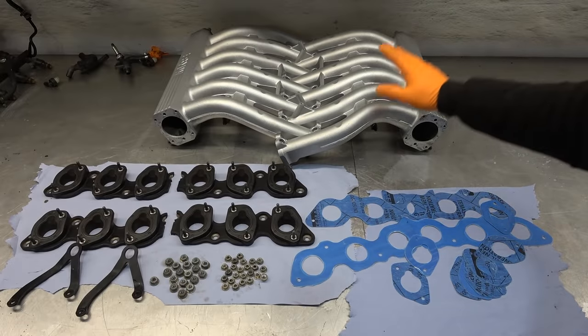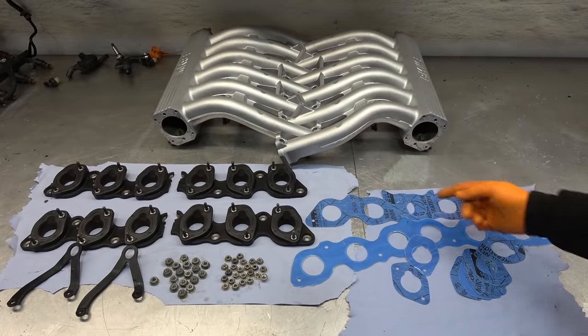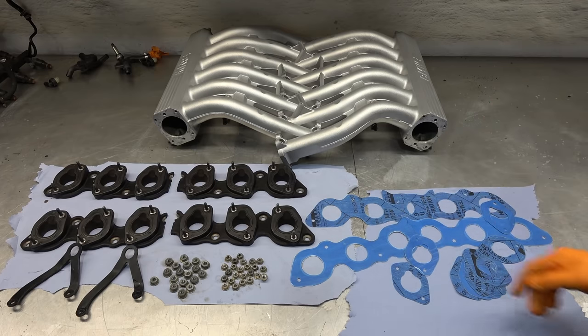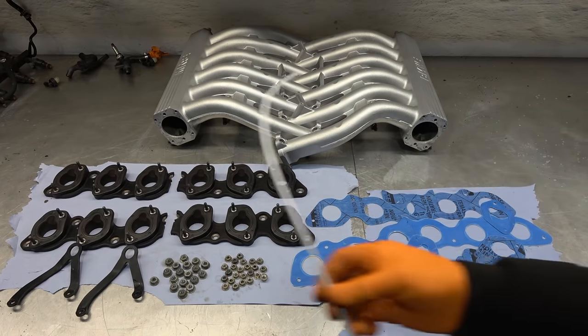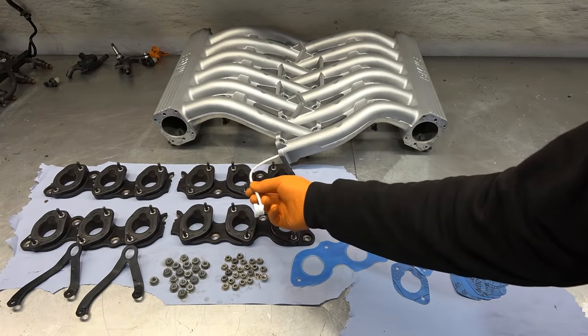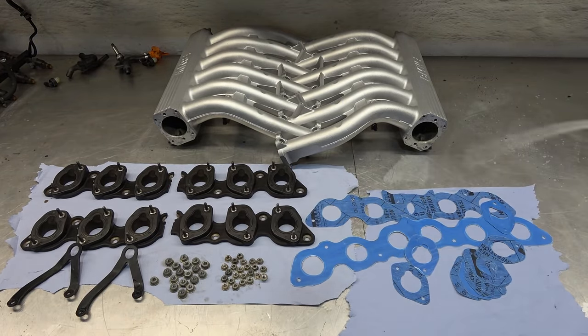I ended up spending more time cleaning up these intake manifolds. There's oil residue all over inside and that's a perfect place for media to stick. So I used about 4 or 5 cans of throttle cleaner with long tubes and just sprayed the crap out of them. Then more water, brake cleaner, compressed air — dry them and repeat many times — and there's no chance there's any media left inside.